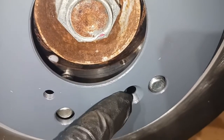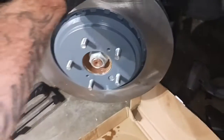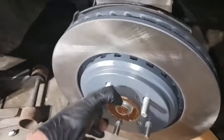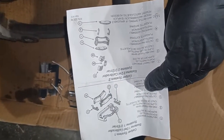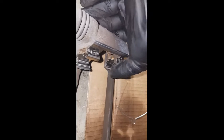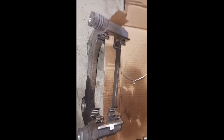Find the inner hole, then the outer hole. Never a good idea to seat it by impact — better to do by hand. Make sure it's seated properly all the way around, just like that. Do not put petroleum products on rubber — it eats the rubber away. No need to put WD-40 on these. Put the shiny hardware on with just your hand, no grease needed to help pop it on. Push it down with your thumb and it snaps right in.